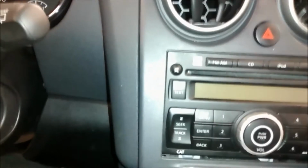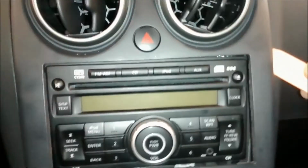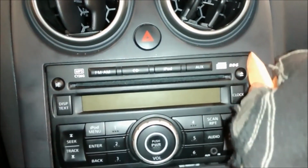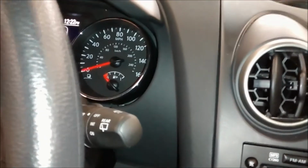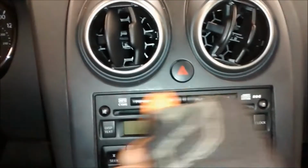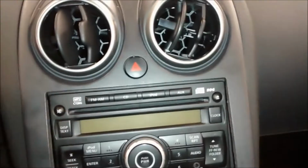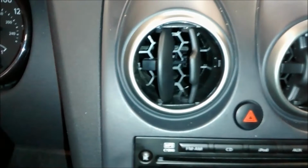So you go right here and you wiggle it, and you can use your pry bar and just go up. Keep going up on this side till you see this little opening right here. You see that little slot, then you go on the other side and you repeat it. This way you take out the panel evenly and you don't break clips out. So you just want to go like so. Just little gentle pushes till the panel comes out, and then you can feel it, like you feel that something else is holding it. So we have something holding it up on the top.